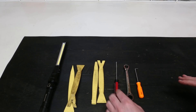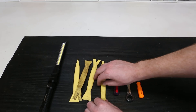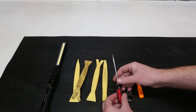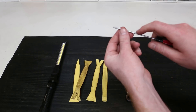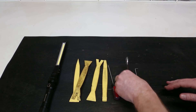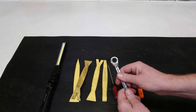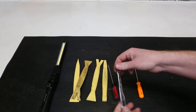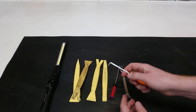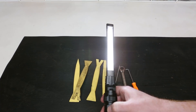These are all the tools you're going to need: a pry bar set — you'll need a variety, these are the two I use most. A flat-head screwdriver works in place of pry bars if you want to get in there and get little clips out. A 10-millimeter ratcheting wrench — you're really going to need this, I don't know how you'd do it without it. Definitely want that, plus a small metal hook for pulling out little clips and pins, and a light source because it is dark in there.